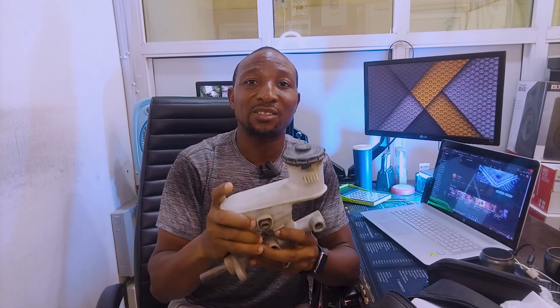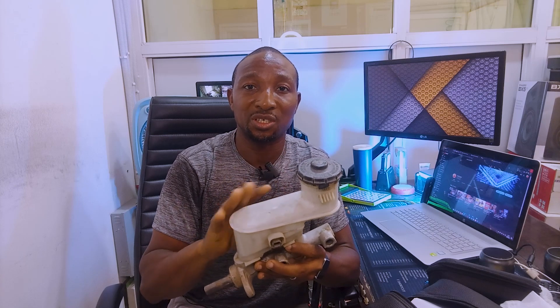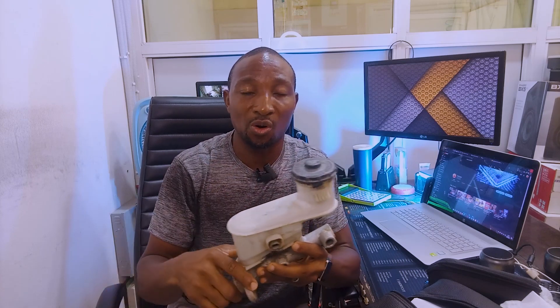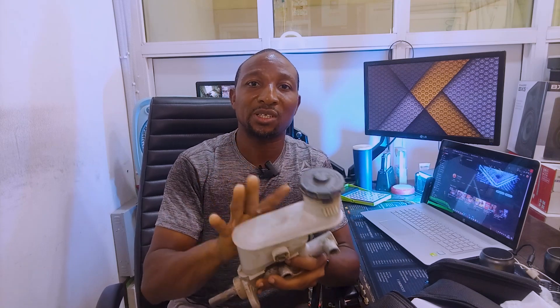This act is wrong. Because by the time you change your brake pads and the pistons are pushed back, this reservoir will start overflowing and all the brake fluid you've added will spill. So it is not advisable to just add brake fluid to this reservoir, because after that spill it might look like something is leaking somewhere.